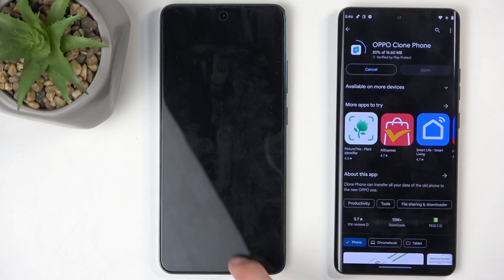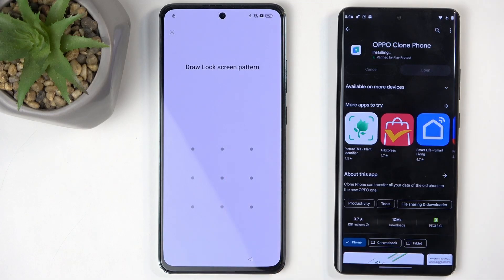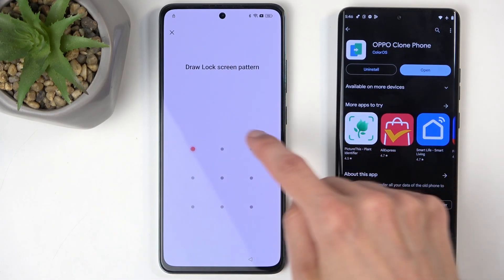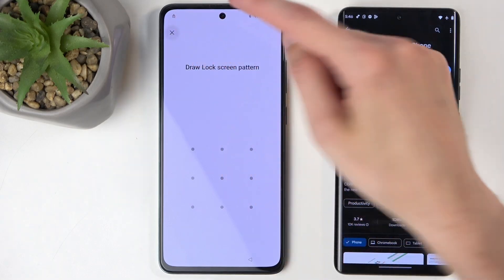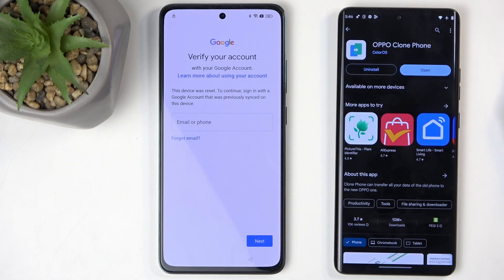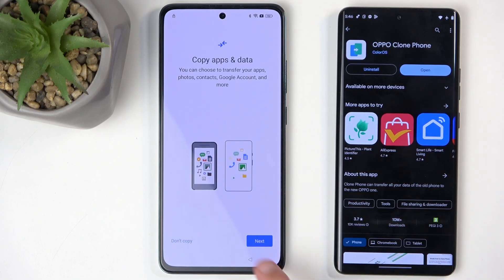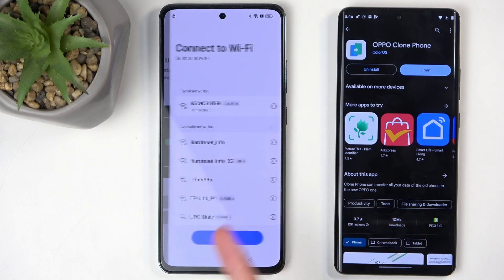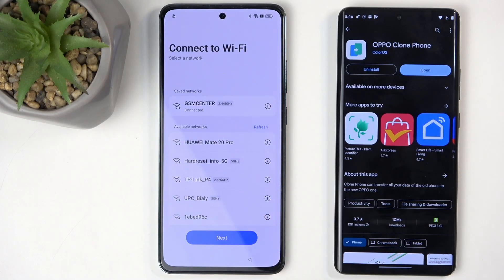So Clone Phone is installing now. Let's move over to our locked device. Here, just to show you — it is locked, requiring you to draw the verification pattern. If you close this, it will ask you to use a Google account to verify instead. We're assuming we don't know either one of those. So what you want to do is back out to the Wi-Fi connection page, or if you're at the very beginning of the setup, progress forward to the point that says 'Connect to your network.'